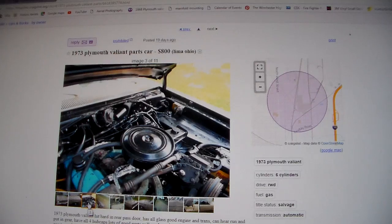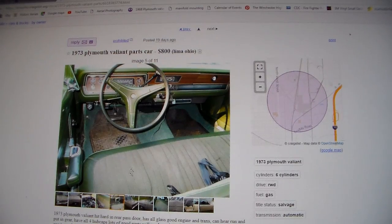It's got a pretty good-looking engine bay. The only thing I don't like is someone who was not a Mopar person blacked out the engine compartment — Mopars never had the engine compartment blacked out, ever, unless it was a black car. That would have to go. It's got air conditioning, a three-speed wiper motor, and electronic ignition like it's supposed to have. It does not have power brakes — it'd have a booster if it did. It's got a pretty nice, up-level interior with wood trim on the dash, air conditioning, and the vent still there. You can tell it's got power steering because of the power steering wheel design.